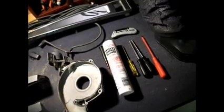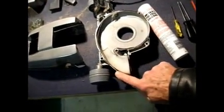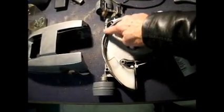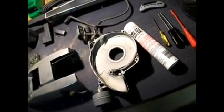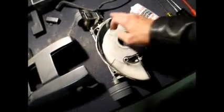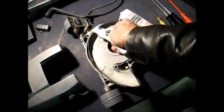Now a quick video on this, so here we go. Tools you're going to need are a Phillips screwdriver, a couple of Torx drivers, your small screwdriver, and this silicon sealant, which we'll be smearing around this edge here all the way around. Because if you don't put fresh sealant on there your machine won't operate to its proper standard — it'll leak and you'll get a much reduced suction. So we'll be replacing that sealant and scraping the old off. You'll need something sharp — I'm going to use this scraper.